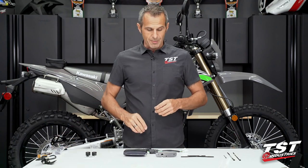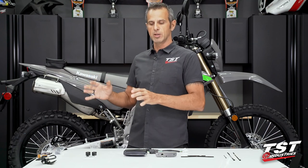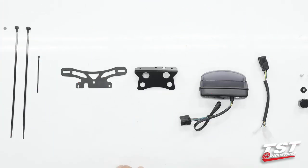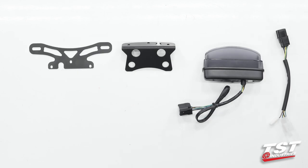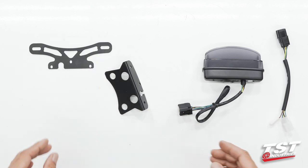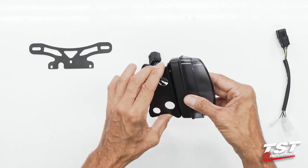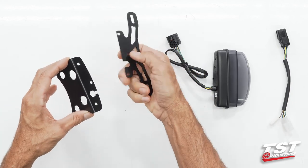Let's start talking about building some components into a chunk, and then we'll get on the bike, disassemble it, mount the pre-assembled chunk, and then reassemble. I'm going to pre-configure the first chunk that we will need to transfer to the bike. This is the carrier bracket that holds everything onto the bike. It does have a split in it for the purpose of passing our grommet through. The license plate bracket also has that split and needs to align like so.